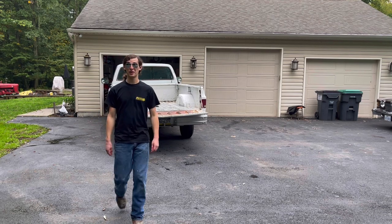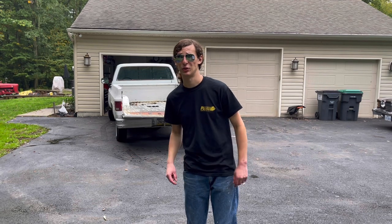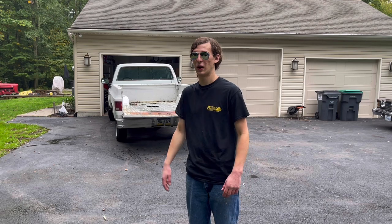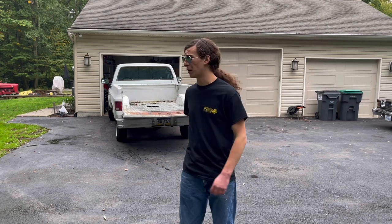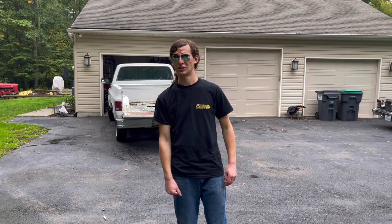I'll tell you what, she is not too happy about being driven, I guess, because the carburetor's all out of whack, the clutch is super touchy, way more touchy than I remember it, so that might just be from sitting or the fact that I haven't driven it in a while, and the brakes, as soon as you touch them, they want to lock up pretty good, so we're going to have to go over all that pretty soon. But I just had to keep tapping the gas in order to even get her to move at all, because she just wanted to die. I'm guessing the accelerator pump in the carb was probably shot, but we'll figure out a way to get her in the garage. There's very tight, limited space in there, so I might have to move some stuff around, but I'll take you guys in there once she's in.